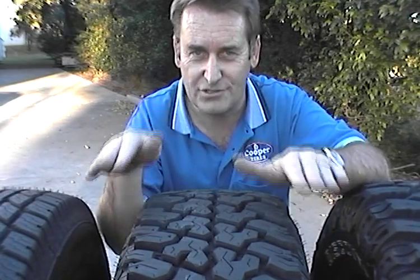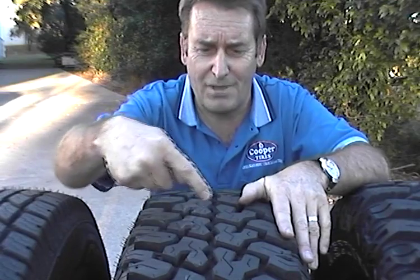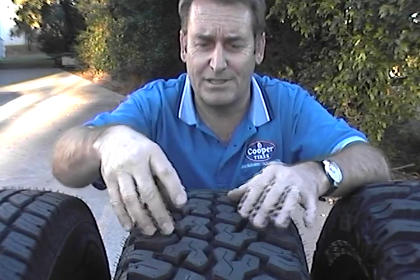It's absolutely fantastic. The sharp edge gives that stability in cornering when you're driving fast on dirt roads, makes it really stable. The offset lug is simply designed to dig below the surface and give you more traction. But watch out in those sharp, steep climbs if they're rocky, because they will rip those lugs. They're only small. They're really designed for the extra traction you need. Notice the tyre is open all the way through the tread pattern, whichever way you look. And that's simply to empty the material out of it and get more traction.